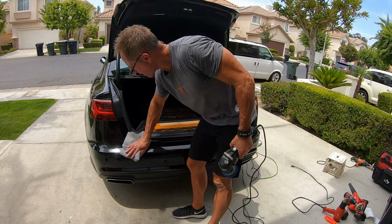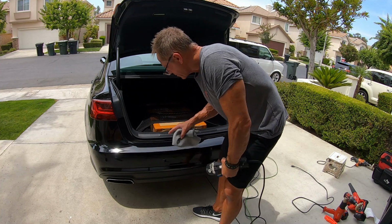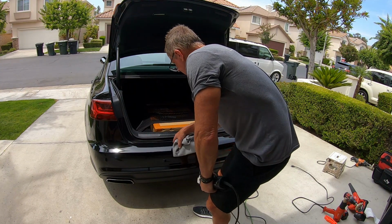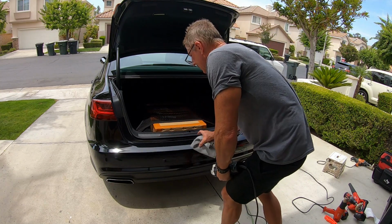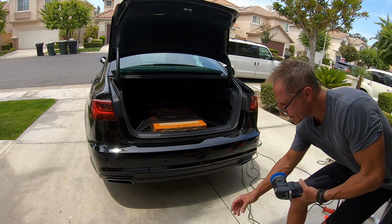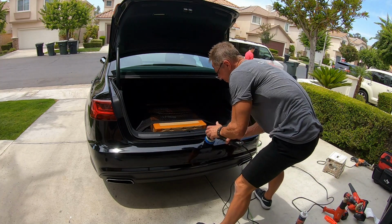Always use a microfiber cloth. It is the safest, friendliest cloth for your clear coat. So now I'm scrutinizing a little tighter. Now I know through experience that I would never want to remove these deeper ones 100% because I knew that it would severely diminish the integrity of the clear coat. But I can clean it up, so from normal viewing distances, this looks tons better. I'm going to do repeat application of my polish. Doesn't take much as you move forward.